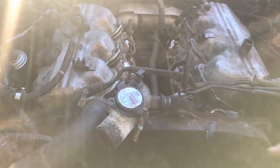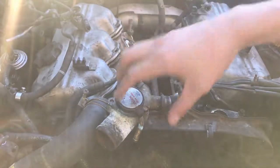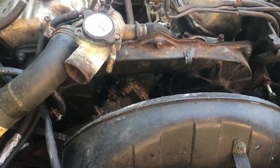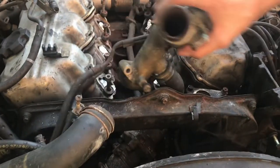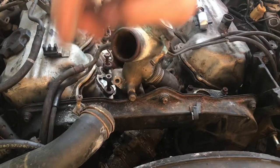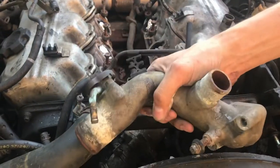There is one small Phillips head bolt underneath here that holds the timing cover onto the engine. I'll have to remove that to get this metal thermostat housing off. You can remove the bolt with an 8 millimeter socket. Once that bolt is off, this coolant hose will be freely able to move. Now remove the bottom hose clamp with a flathead screwdriver.